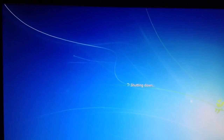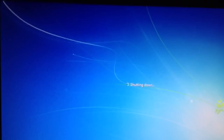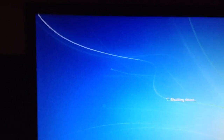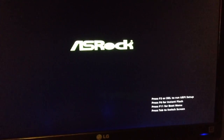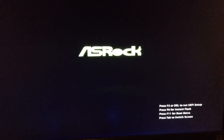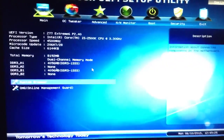Now this video will just be briefly showing you guys how I overclocked my Intel i5-2500K to 4.5 GHz on the Asrock Z77 Extreme 6 motherboard. So basically, to get into your BIOS, you want to spam delete or F2, whichever suits your fancy.